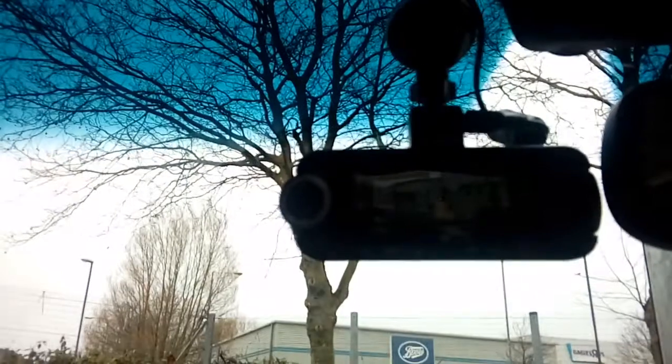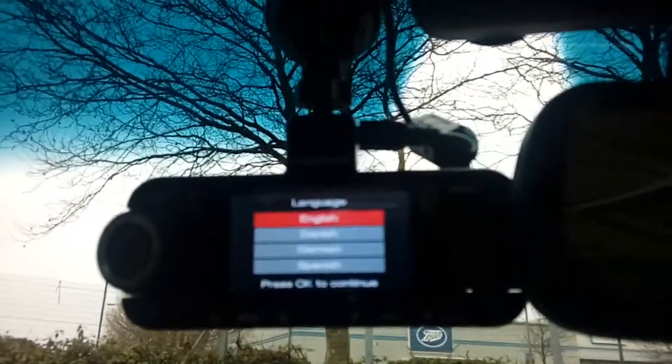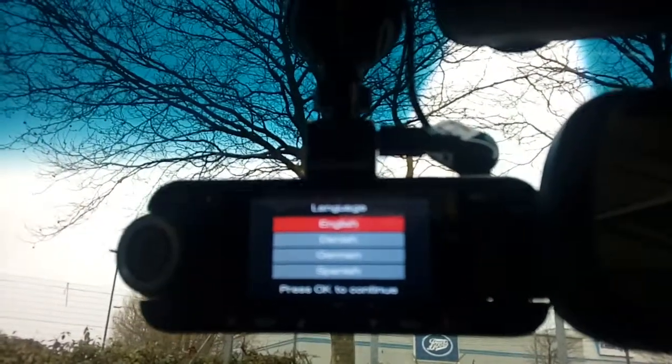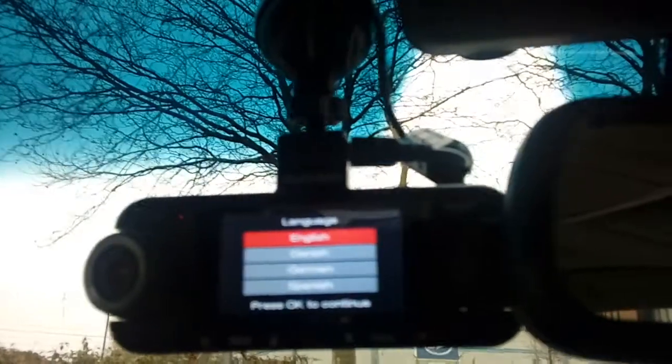We'll now try the camera. Camera up in place — we've just dummy-fitted this up just to test the power side of it. I will just say most cameras come with two mounts: a suction mount and a 3M sticky mount. If you mount it to the actual glass the suction mount normally works fine. If however you've got this black textured painted surface on your windscreen you're going to need to use the sticky 3M mount, because the suckers don't stick to them very well. Try and keep it out of the windscreen wiper area because obviously it'll fail the MOT — keep it away from the sweep area so it's not obscuring. Put your power cable in, then switch your ignition on. Ignition on — and there we go, powers up as expected. You have a little battery symbol at the bottom; when you finish setting it up it'll have a zigzag through it showing the item is getting power, with batteries only there for parking mode etc. Switch off again — it will need to charge the battery for a couple of hours on a new camera, bear that in mind.